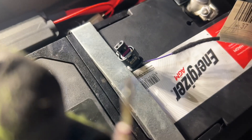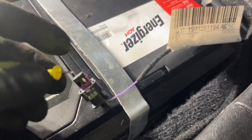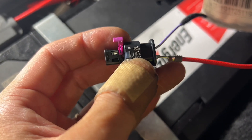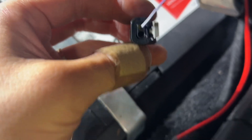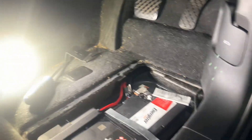One thing we also need to make sure we do is put this in here. We're going to take out that blue piece right there — I use a tool just like this to wiggle it out. To plug this in, you see that purple piece — you've got to move that purple piece so it gives you space to insert this into this hole. Then we just plug in the OBD reader into the OBD port.